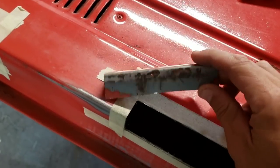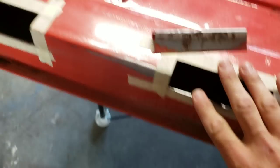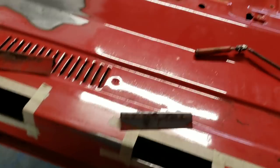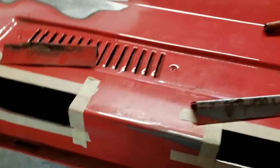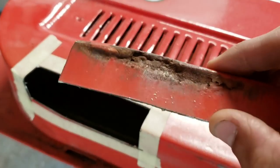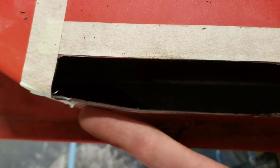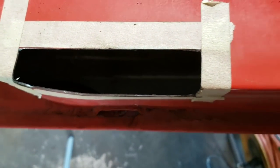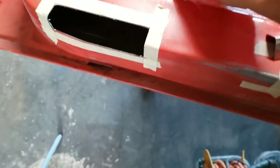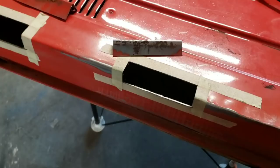I know I can fix it, but it always freaks me out when I cut into a door like this. It's just so clean — I should just leave it alone, but I can't. I have to fix that. And you can actually see where this was kind of warped — it starts to curve up, but not that drastically, so we can actually fix that while the metal's off. We can bend up some new stuff, weld it in place, we'll be good to go.